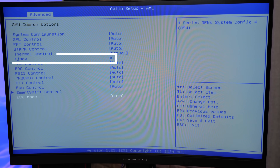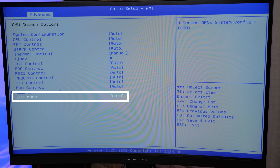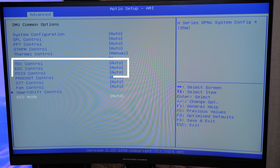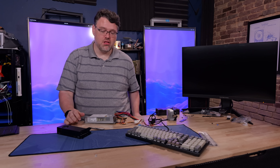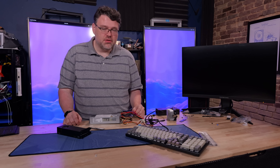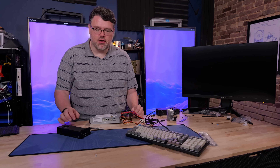This platform is configured with a TjMax of 90°C, which is overridable in the BIOS. It also supports Eco Mode, which will lower the power the system uses. You can also fine-grain control that with TDC and EDC control in the BIOS. The power specs are very impressive — out of the box from the wall with my 80 Plus Gold power supply, we're talking like 65–70 Watts before adding anything. A neat trick for testing: booting off the network. That is extremely low power. It doesn't have out-of-band management, so there you go.